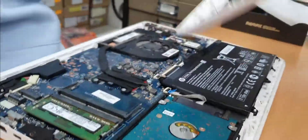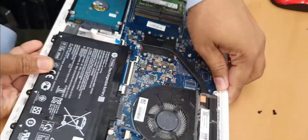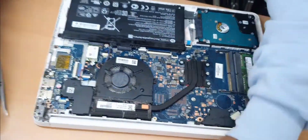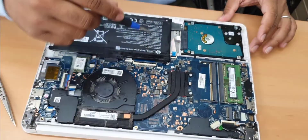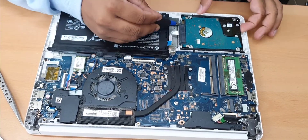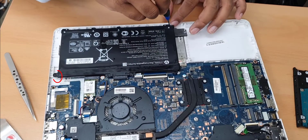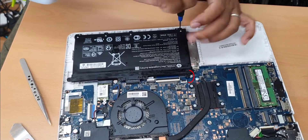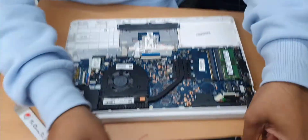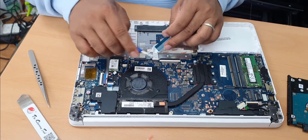Okay, it came out. Looks like there's water damage in here. Now we're going to remove this hard drive connector — there's water in there as well. Take this out. Now the battery — the battery is secured with one, two, three, four, five screws. Remove all of them. Already disconnected.